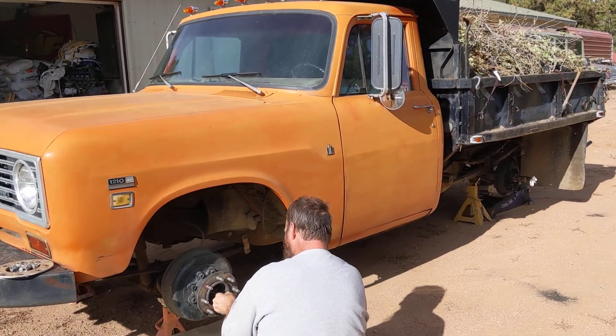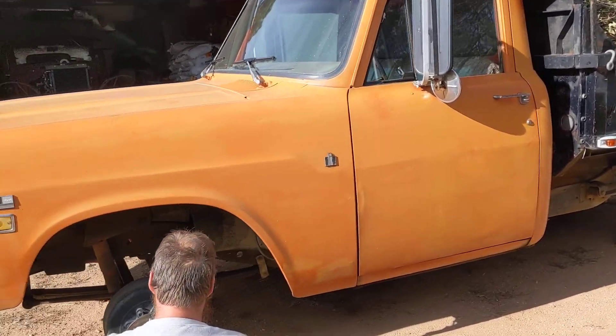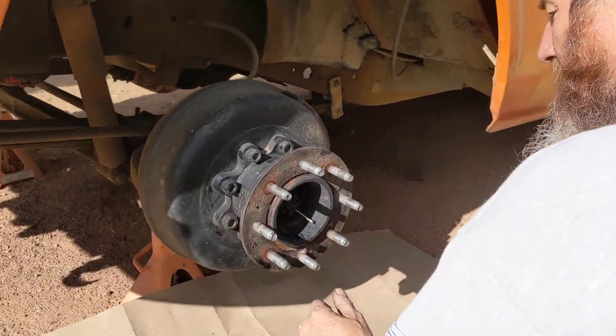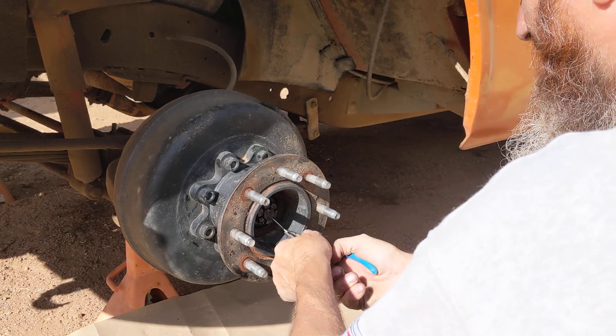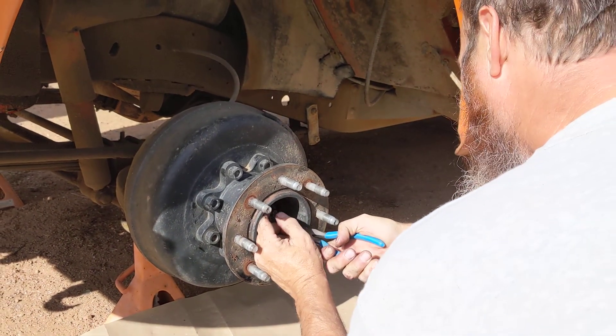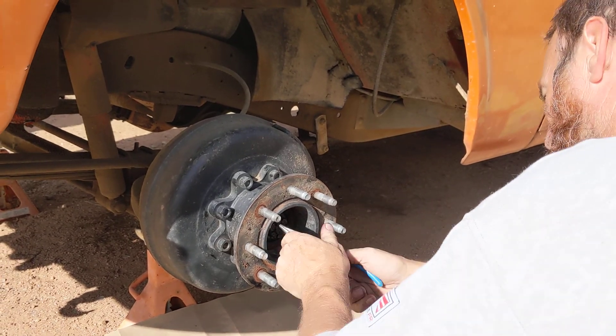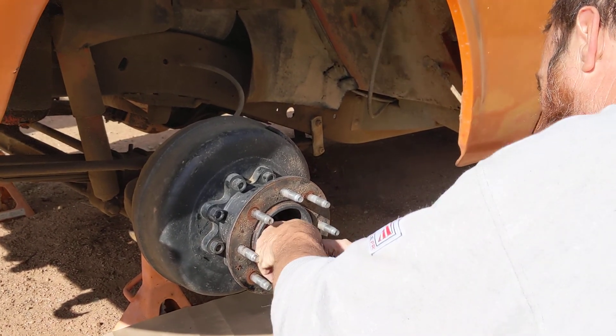This is the dually. And right now, since we've got good light behind us, just did a little brake check — I guess I should have recorded that. But the brake shoes turned out to be good, about 50, 60, maybe even more percent on those bad boys. Everything looked good, no leakage from the wheel cylinder.